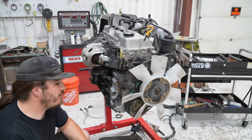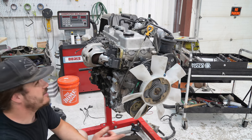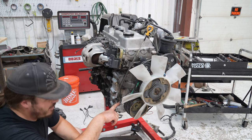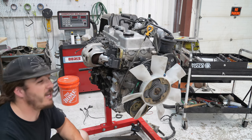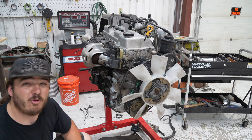While we have the oil pan off, we're going to go ahead and tap the hole where the old dipstick tube went. We're no longer going to be using this location. It's actually going to move around to the intake side of the block. So we're going to remove the dipstick, use a quarter inch NPT tap they supplied and a plug they supplied. So it'll be real easy. We'll go ahead and get that done right now. And then we'll continue on, make sure all the shavings are out of the oil galley, and put the oil pan on and the oil pickup.